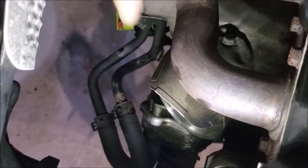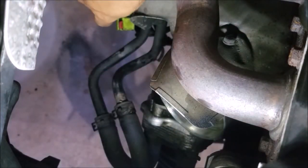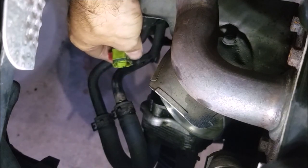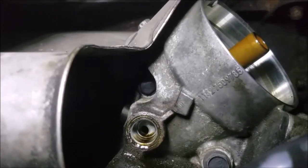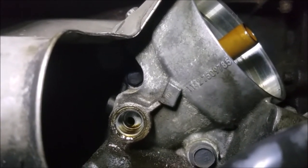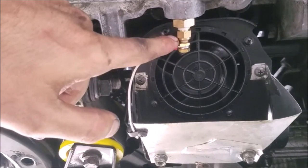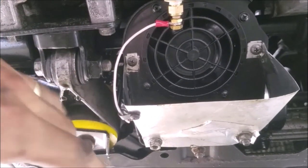Working from the top side, here's where the factory oil filter plugs in — we have that out of the way since we drained the oil. When you release the sensor, it's plugged into the green wire in this little red switch. You have to push from the driver's side to push it out — easier to reach around than use a screwdriver. There's a safety latch so it doesn't come off on its own. With the camera higher up in the engine bay you can see the oil filter on the right, and the plug goes in the bottom-left hole, past the heat shield on the left.